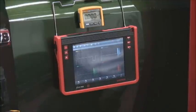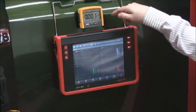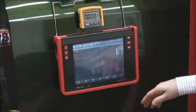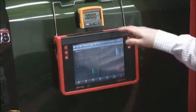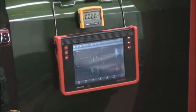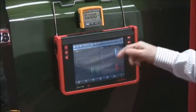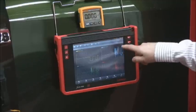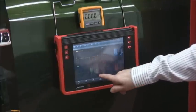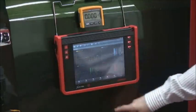Our current draw doesn't move a lot — we can do min-max in a little bit. Give it some very light throttle blips. What you're doing is giving a throttle position command and you're going to start seeing numbers change — you're asking for enrichment basically when you do that. You can see this on these graphs, how it's modulating. Even the voltage modulates a little bit, but if you look at the scale, it's a very small deviation. Notice the current flow really does not move much at all.